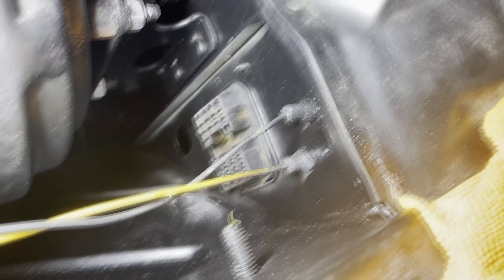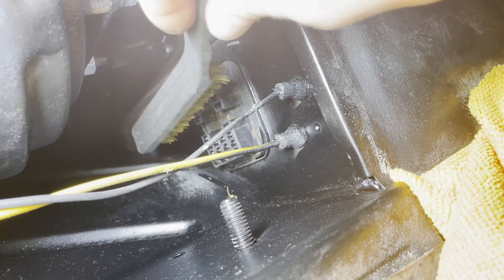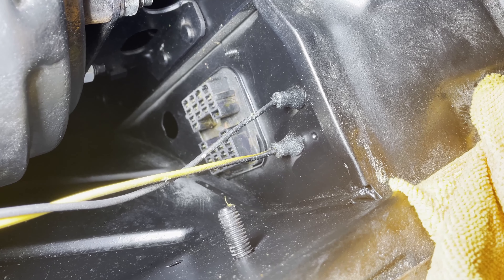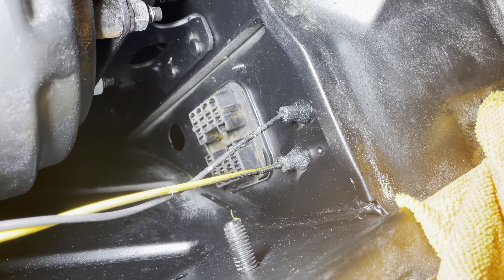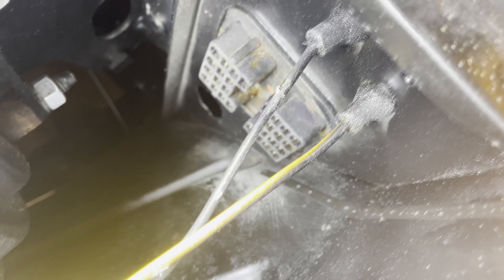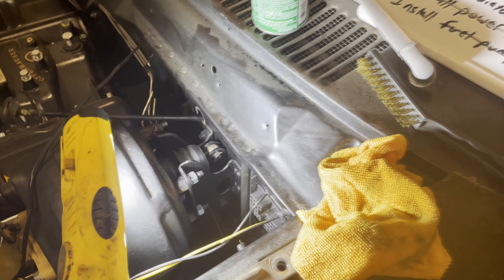What I basically ended up doing — let's see if we can actually see what we're looking at here — yeah, it looks a lot cleaner. It had a bunch of grime and stuff in there. My phone was kind of acting goofy so I wasn't able to record the process, but I basically just sprayed it with some degreaser, got in here with a wire brush and kind of scrubbed around, sprayed it a little more, sprayed it with some water, wiped it down. I repeated that process about three times and blew it out with an air hose a couple times also. Now it looks pretty good. I was an idiot and used brake cleaner to spray the connectors at first, which was a bad idea — so now I'm missing a little bit of paint there. I might spritz that really quick with some paint just to have some coverage. But that part's done.